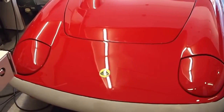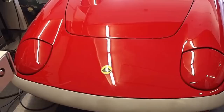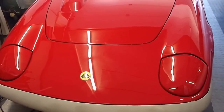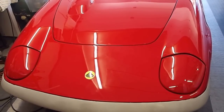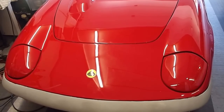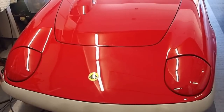I then proceeded to figure out a way of hooking it up so that it would be easy. Since the car has an S4 clip on it, it has the fail-safe headlight system, so I only needed one actuator in the middle to push the bar up. Let me take the hood off and I'll show you how the bracket is.